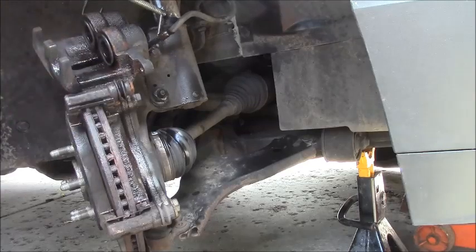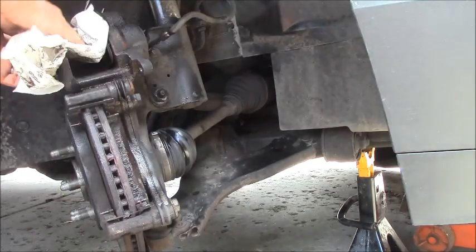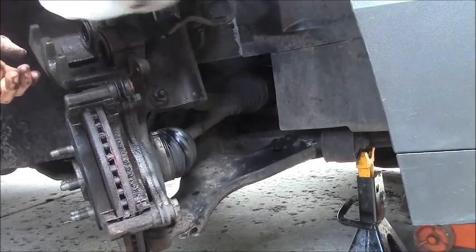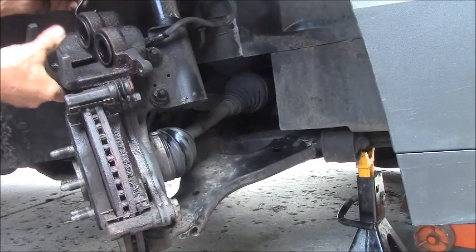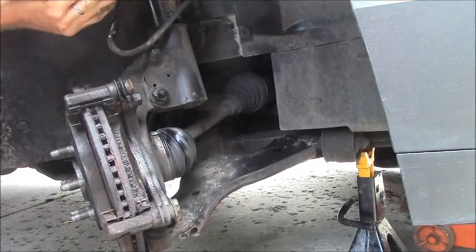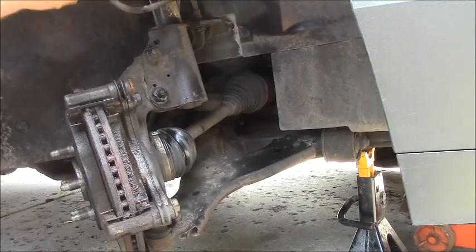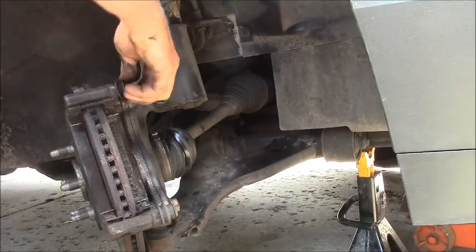See, that's pretty easy isn't it. Now we're going to clean out all this solvent - we don't want any of this lube getting on our brake shoes. That guy's cleaned up. We're going to hang the caliper up. I'm going to put that hook right through there - and both ends are hooked up to the spring. Now that's totally out of our way and not a worry.